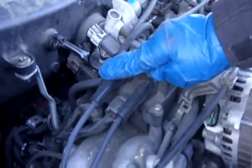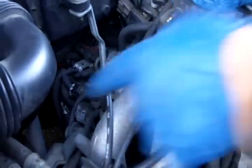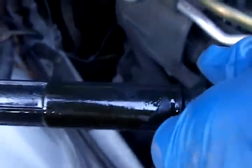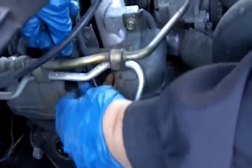This is the first wire I'm going to remove. This is my ignition coil — I'm just going to pull this off. There we go, that's the first wire removed from the ignition. Now I'm going to follow it down and remove the cover off the spark plug. You want to make certain that you grab the cover by the tabs, not the wire, and pull. This entire wire we're going to remove and install a new one. I'm going to feed it through the bottom — that's the easiest way to get it out of there. That's removed; this is the old one and we won't be using it.